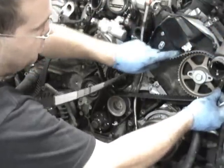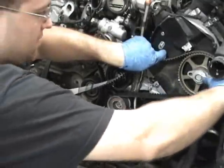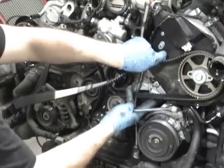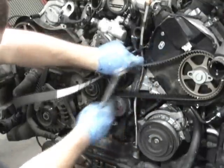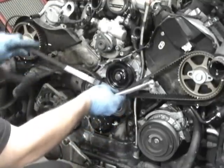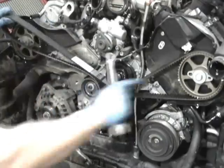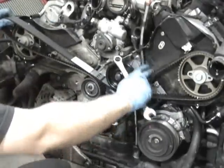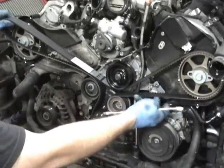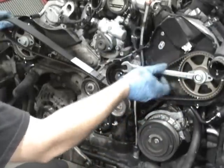And then once you got it on there, you can go ahead and take the slack back out right here. Once the slack's back out, look, everything's lined up still in the crank and that gear. Then we come across here, and this is where the fun begins, because now this needs to stay tight. So tight, tight. We look, we're still pretty lined up. And you got this tight. If not, you can always give it a little bump, keep it snug.